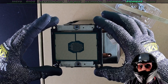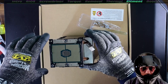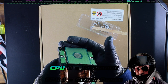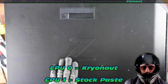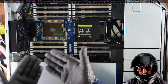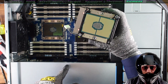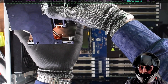Here's our second cooler. This is going to be CPU 1 on the Z8. Again, checking for flush fitment once it's installed to make sure we don't have any problems. Using the spreader method — don't forget thermal paste. I'll point out that one of these CPUs has the stock thermal paste and the other has Thermal Grizzly, giving us the opportunity for a unique test. Check out the golden triangle — definitely important to align those, otherwise we're going to set this up incorrectly.